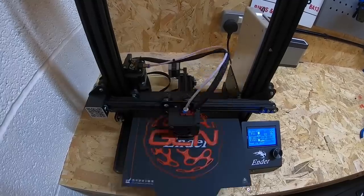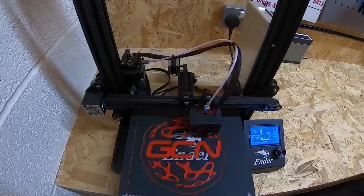They've also mentioned a question about 3D printing. What I would do — the best bet — is to find a second-hand or used front derailleur mount. That way you've got the correct part for your bike and you haven't got to make or modify anything. If that isn't an option, yes, 3D printing could work, but it's going to be quite complicated. You've got something to design the part, and 3D printing in a method that is particularly strong. The front derailleur takes a lot of hammering, and it's going to be expensive. Easiest option: run 1x.